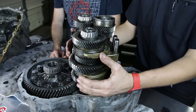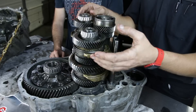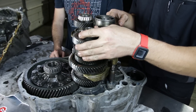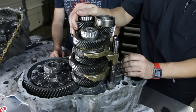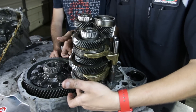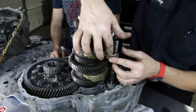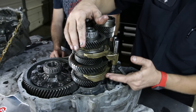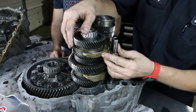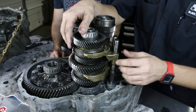Going backwards from that, on these particular Volkswagen transmissions, they split what we call the output shaft into two in order to make the transmission a little bit shorter. So we've got first, second, third, and fourth gear on this shaft, and fifth, sixth, and reverse are on this other shaft. They're each geared to the differential down at the bottom. To select between the different gears, these are our shift forks — the brass shift forks, which are sometimes a problem for people that shift very aggressively. They can break, so there is an upgrade to steel available, which we've covered in another video.